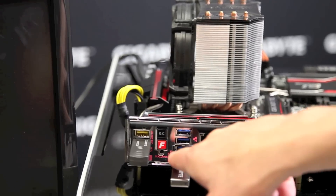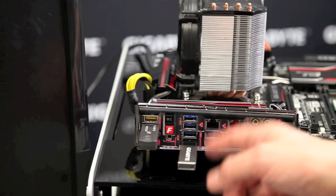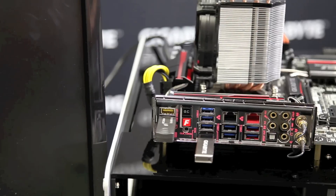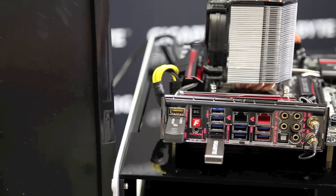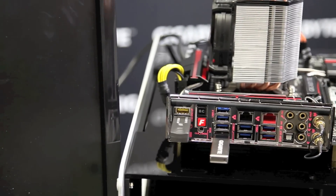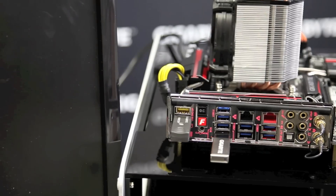So now you can see the LED light here — this is actually updating and flashing the BIOS right now. When it's completely finished, that LED light will actually stay on so you'll know that the BIOS is completely updated. So you don't want to remove that thumb drive until it's actually been updated.